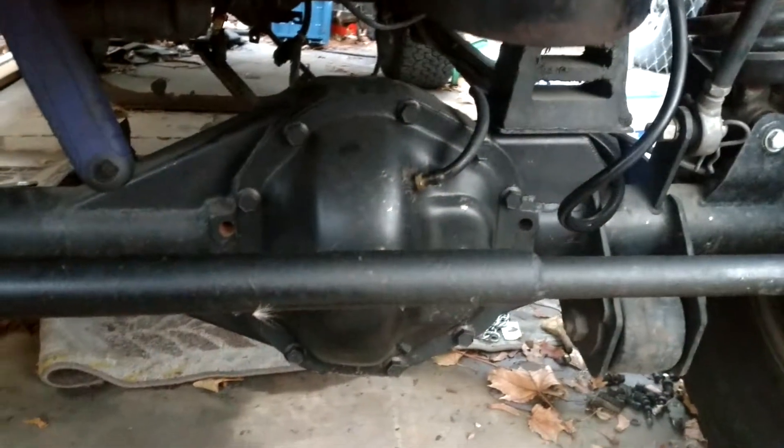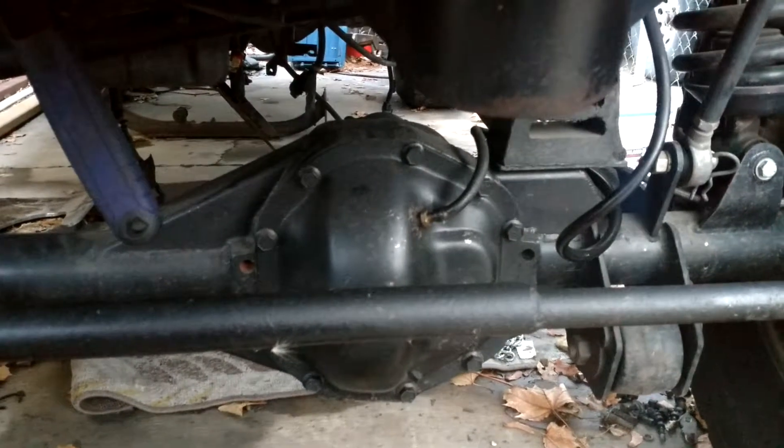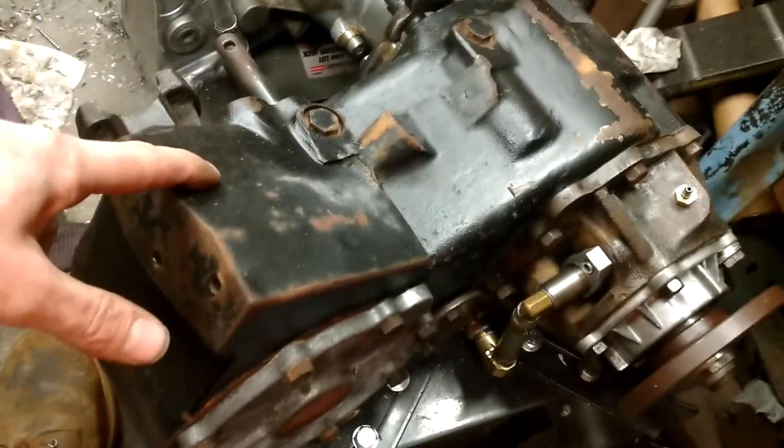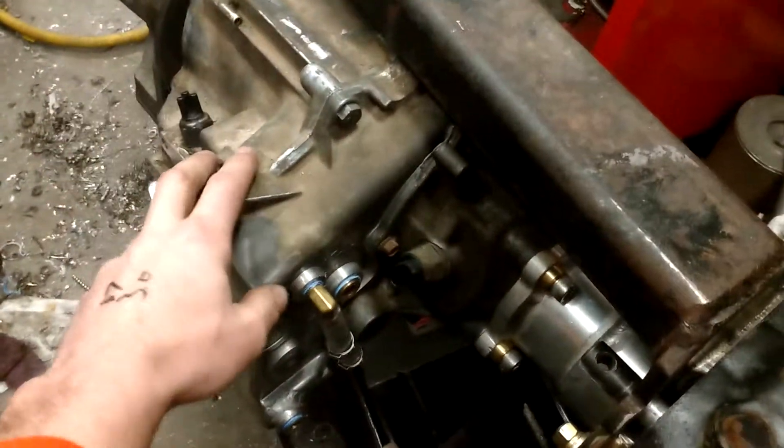As you can notice, it is driver's side drop. So I'm going to real quick talk about this transfer case setup. What I've got here is an NP205 out of a Ford — driver's side drop. I have my factory 233, which is basically a 231. It does have a slightly wider chain in it.